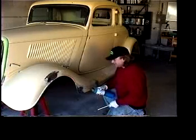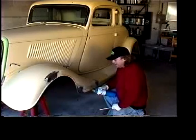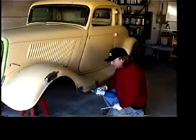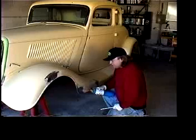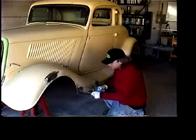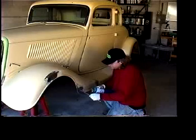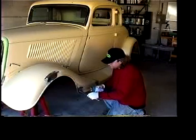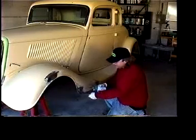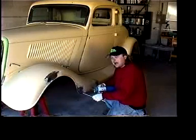I used to use a lot of this stuff, and I found out that that took forever to file, and you just burn through this. This is very expensive stuff. So a better way that I found to do it is to apply the right amount and really work it with the paddle. You see that the panel should get hot enough to just take the lead and stick it to it, much like soldering a copper pipe in a joint.